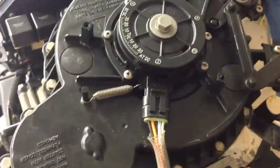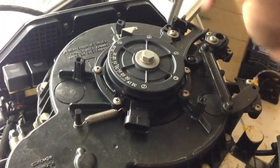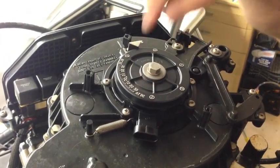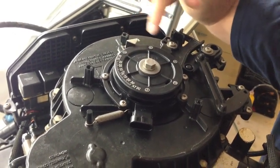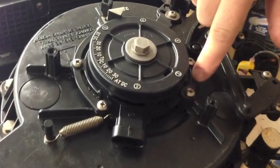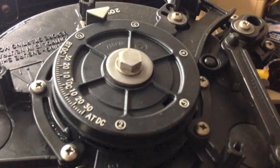These three screws pull this cover off. This is the optical sensor right here — we'll go ahead and remove this plug. As you can see, this moves freely; this spring pulls it back in. This is the timing ring. There's a woodruff key on there that keeps it in one position, so we don't have to worry about it. We'll make a mental note that it's right here in between the 5 and the 6. We'll remove this bolt and then remove these two retaining screws — I think there are three on the other side as well. Then we'll be able to lift this entire assembly off to access the optical sensor from underneath.